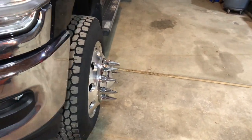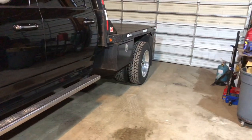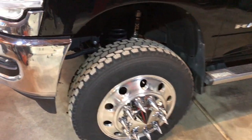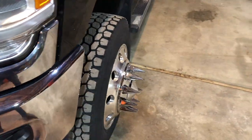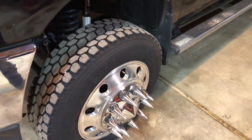The company I went with is out of California. I called them and asked if it's going to work on my truck; they said they don't know, they just make the wheel adapters. So I crossed my fingers. They told me my 2019 should have 8-on-200, I verified online, and sure enough it does — that's when I found out that 2019 and newer switched over to 8-on-200, Duallys only.